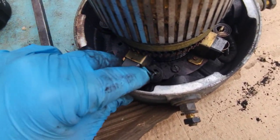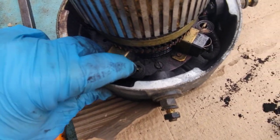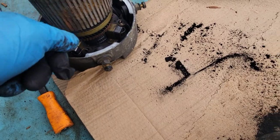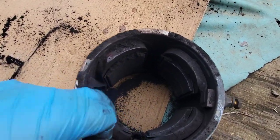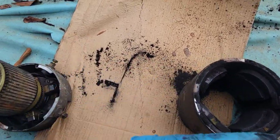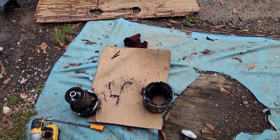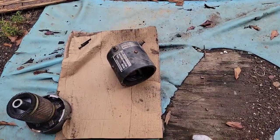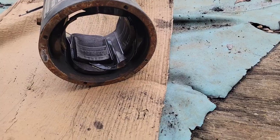At least I know I'll have it fixed now. I'm just going to take my air compressor and blow everything out real good. I want to get all this carbon dust out of there so when I put the motor back together, she'll be good and clean and ready to roll. I just blew that out and, man, what a difference. Now the magnets are all nice and clean.